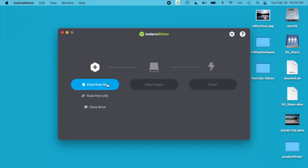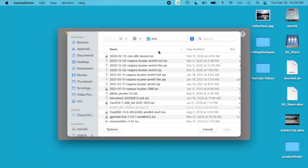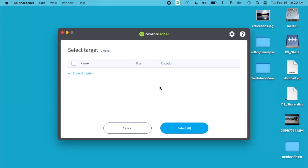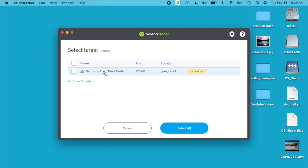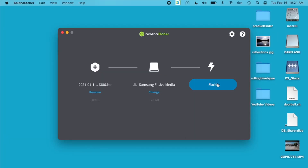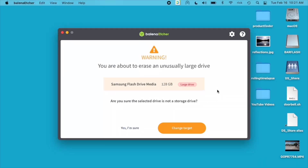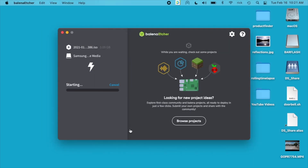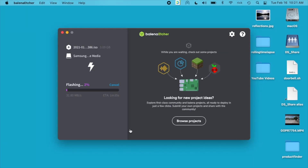Raspberry Pi is a small computer that runs Raspberry Pi OS, but they make a version that runs on Macs and Windows. It works for this task so that's why I'm using it. Go down and you'll see download for macOS, download for Windows, download for Ubuntu — download the version for your system and it will download an image file. Once you've downloaded and installed Etcher and downloaded the image, open up Etcher, click on Flash from File, navigate to your image — mine is in an ISOs folder — select the Raspberry Pi OS buster i386 image (that's the Intel version), hit Open, then Select Target, insert your USB drive, check it, hit Select, then hit Flash.